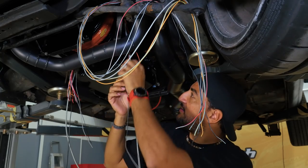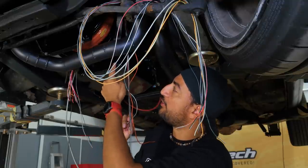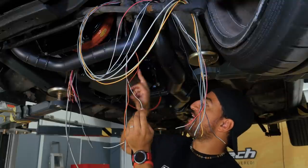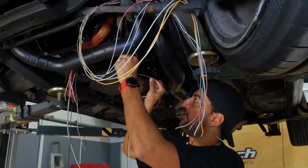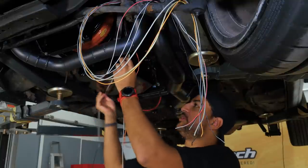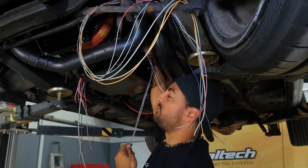There is a gearbox temperature sensor - I'm assuming the temperature sensor will probably go here and try to face away from this exhaust pipe, but it may also get tapped further around in this pan. I'm just leaving it long enough for now so it can go pretty much anywhere all around to the back, and we can tuck it all the way back up on top of the bell housing, so it's not really a problem.